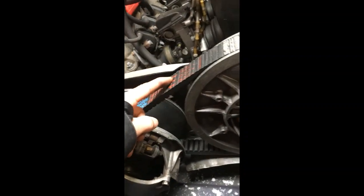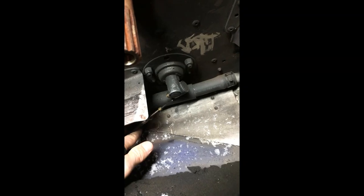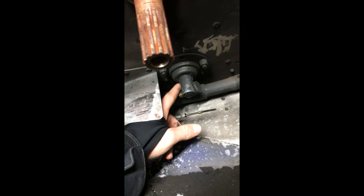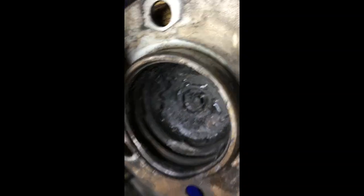Next step: come around to the other side of your secondary clutch. You're gonna want to loosen the bolt first, then take off the belt. After you get your primary clutch out, the speedo cable comes right out. There are three bolts — take those out. Look what we found here: this whole bearing's gone too, all rounded out in there — just bad.